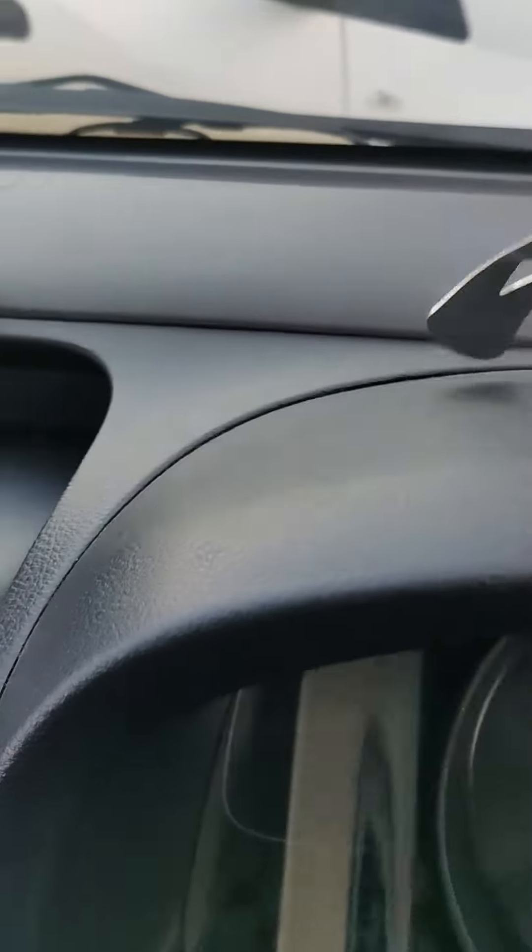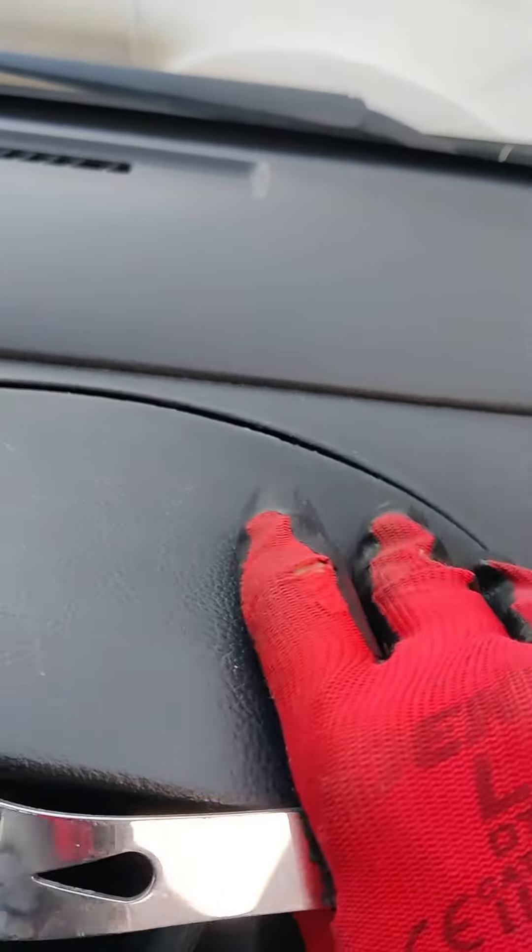At the tops here, these two on either side, there are two clips. The idea is to disengage the clip by pushing down. You might need to swap it over, and basically as it goes down on both sides you'll see the trim move slightly and it will then just literally pop off.